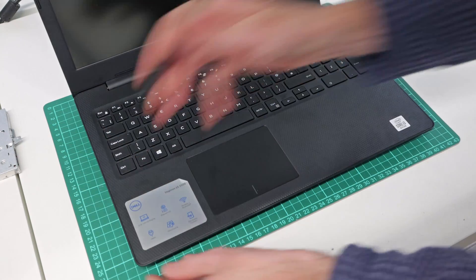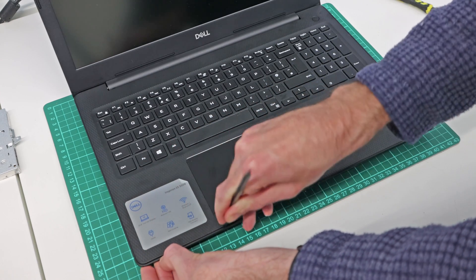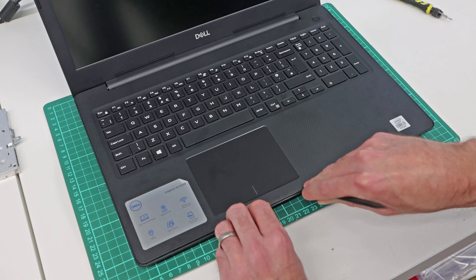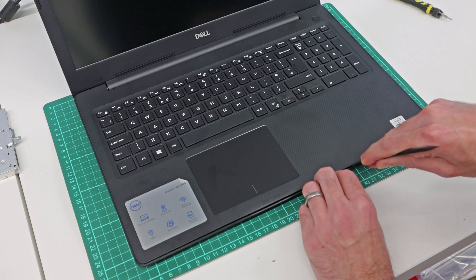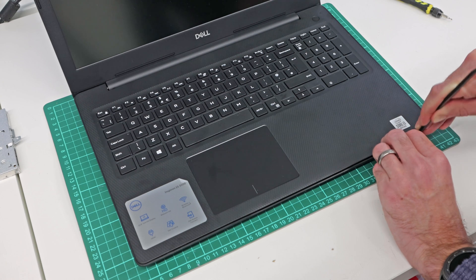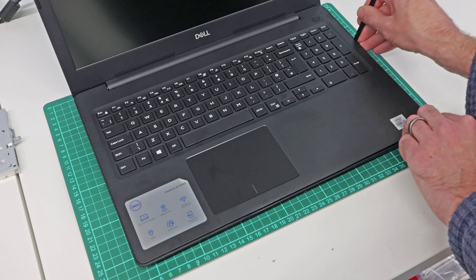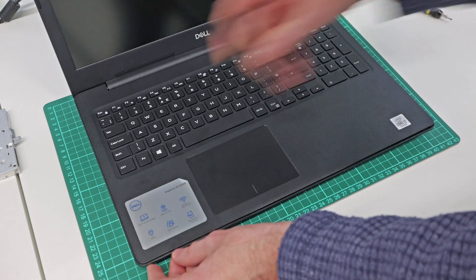It does not really want to move anyway so I'm going to start at the front as I normally would. What we're going to do is just gently press this in straight down to push out the base panel and in doing so just separate it out. As we work our way around you can see we're just releasing the clips.